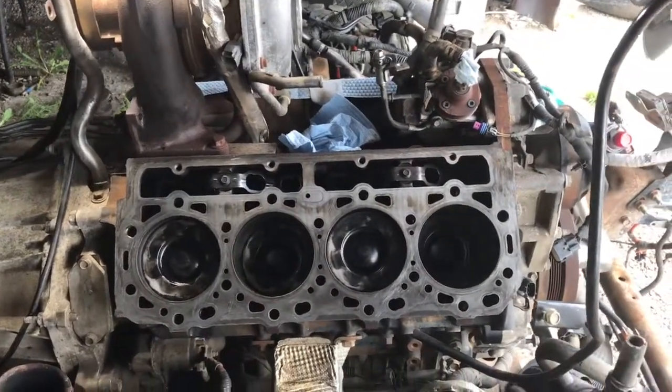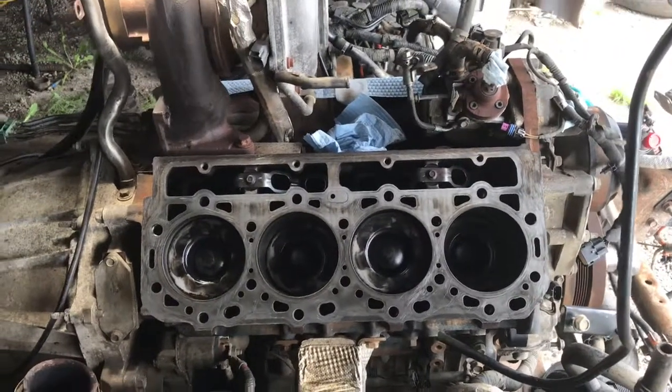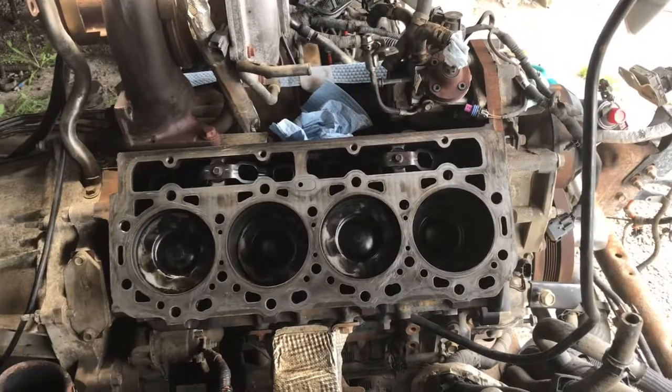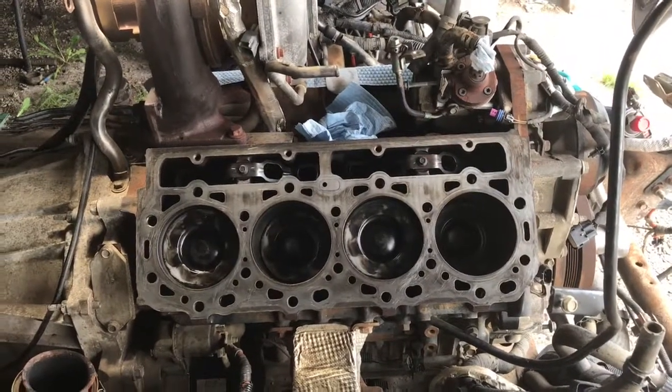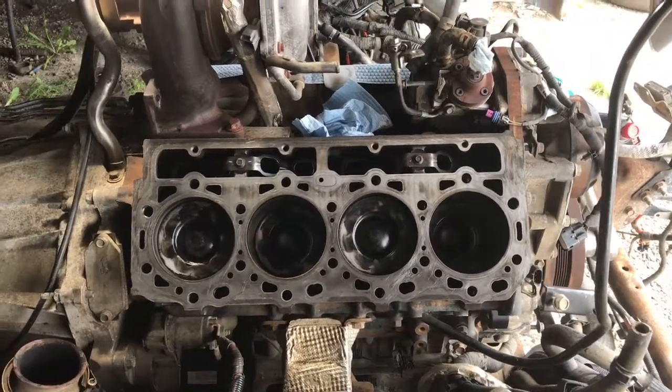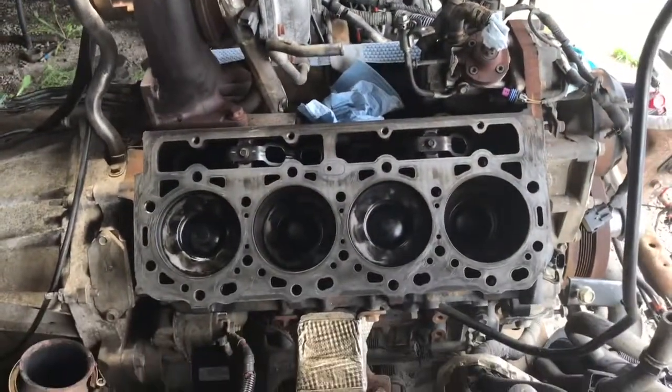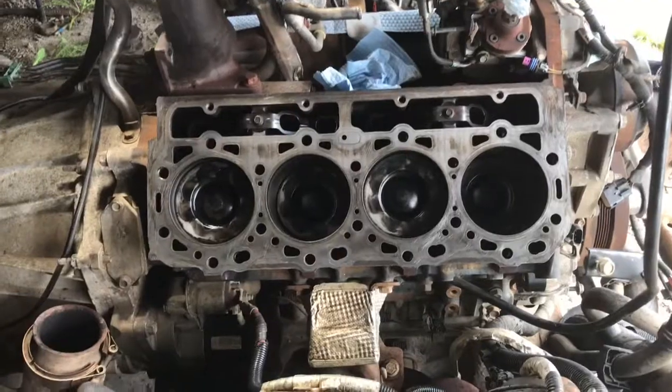Not quite, but like five hours maybe. Got the thing cleaned up. The deck has a little bit of black stuff left there, but there's no more chunks. The gasket's all gone. The surface is nice and smooth, both sides. The other side I got covered up so I don't blow garbage in there when I'm blowing the junk off this side.